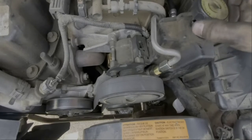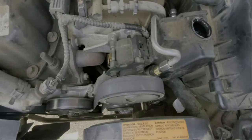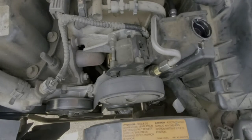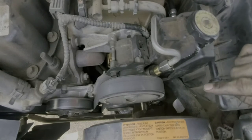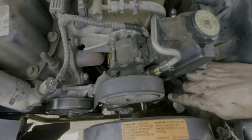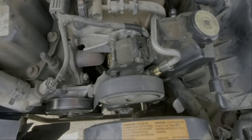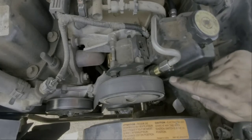Now that it's tight, I'm going to top off the reservoir for the fluid I lost, then start it up and check for leaks. I'll also go underneath and wipe off all the oil on the lower parts of the car, because residual fluid may make it look like it's still leaking when it's not. Make sure you clean off the steering box and lower radiator hose area. When checking for leaks, look at both the top and bottom hose connection points at the thread area.